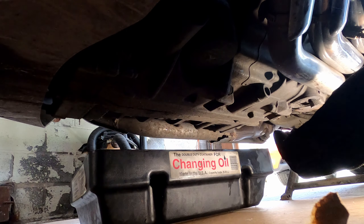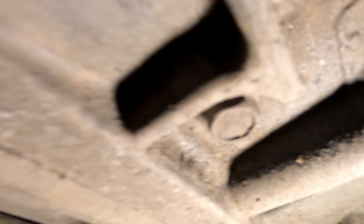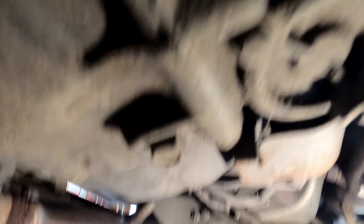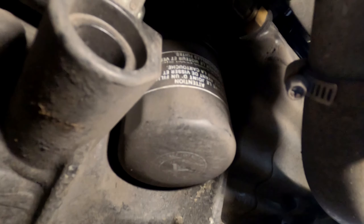There's one right up under, two right next to it. Let me get the light under here so you can see better. Those two right there — that's one, two, and then three is back here. That third drain plug — this cover right here is where the DCT filter goes. They take that cover off and pull out the DCT filter. And this is where you see the engine oil filter right there, pointing downwards and out the side — looks like a standard car oil filter or a Harley filter.